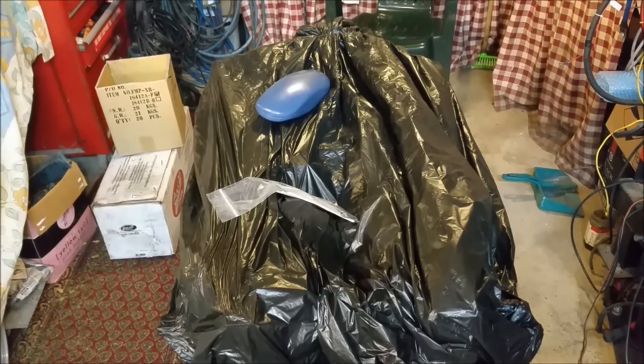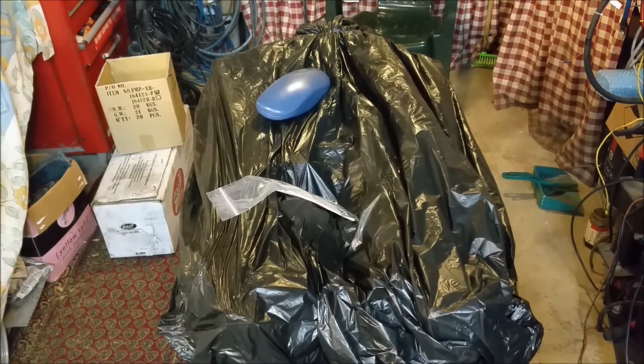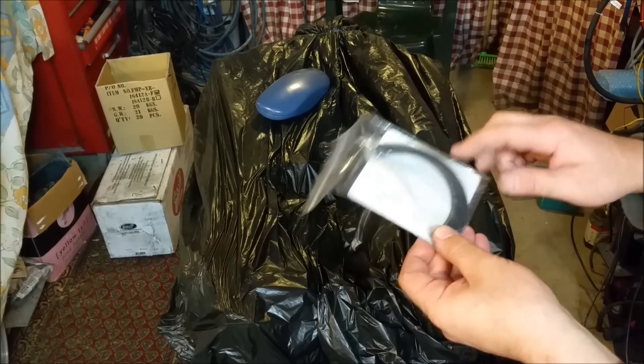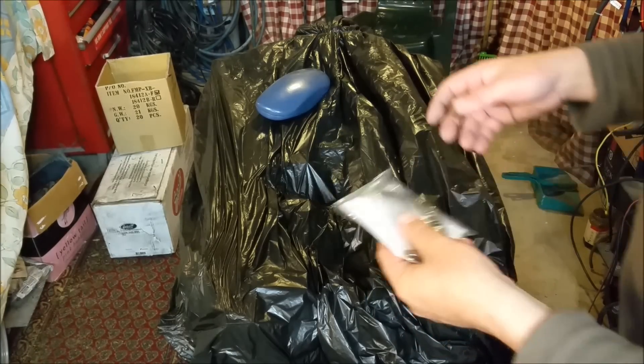Sit back, enjoy, leave comments as you find necessary and I'll try and answer them as they come in. Today I went to reassemble this and I couldn't — that was the end of the last video. So today I've gone and bought the correct rear main seal, which is the very last part I've bought and the very first part I needed to put it together. That's the rigid two-piece type, not the rope type — I don't like those.